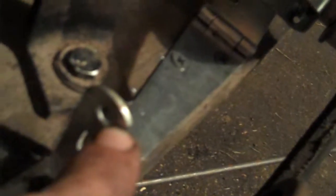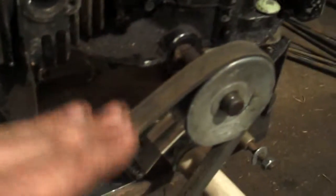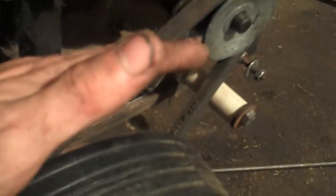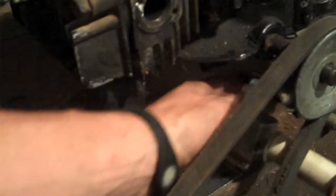In front of that hinge I've added an angle piece using drywall screws. It has a hole where I can attach a cable or rope, and looping it around this piece allows me to pull straight on it — that's the first bend that lets me pull cleanly so it's easy to use. As I pull up and down, you can see the belt tightening. With no tension, the engine spins freely without moving the wheels much, but this lets me tighten it enough to drive.